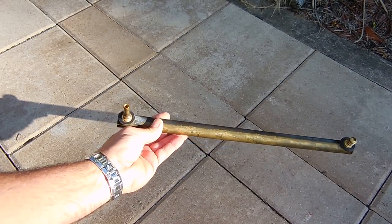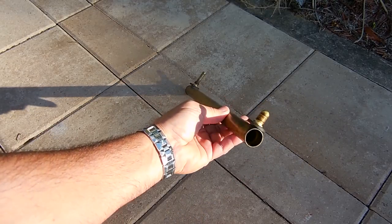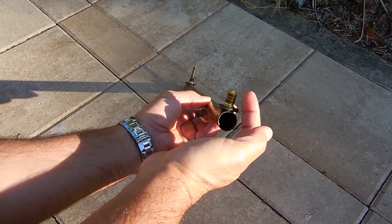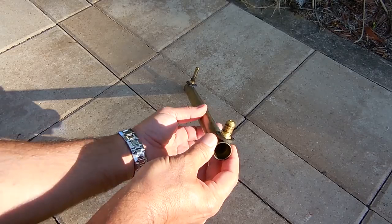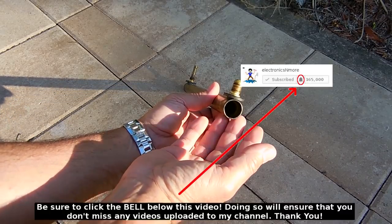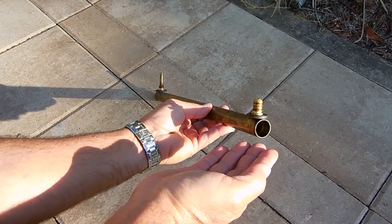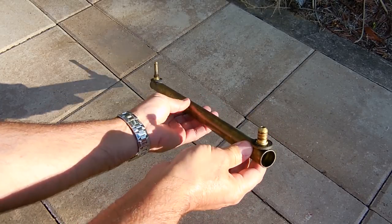This is what it looks like when it's removed. If you take a look at the end right here, you can see it's a tube within a tube, so the walls are very thin — maybe 3/32nds of an inch. Transmission fluid goes in and becomes a very thin sheet that flows all around the inside wall of this tube. The purpose of that is to increase the surface area so the heat can be drawn away from the transmission fluid very easily. Having the hole also allows the coolant inside that plastic channel at the bottom of the radiator to flow around this pipe as well as through it to absorb the heat.